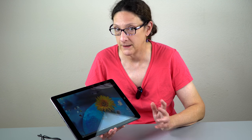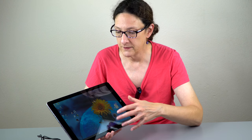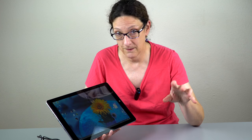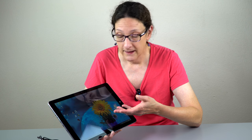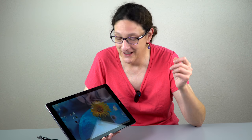The display is in theory the selling point of this tablet. Now, if you have epilepsy, be aware: this is the worst case of PWM refresh flicker I've ever seen — the camera picks up heavy rolling flicker. Though manufacturers often use more than one LCD supplier, and some users report a brighter, non-flickering display. We've tried drivers and disabled Intel display power management, and it's still doing this. In person, you can't see it with the naked eye, and I haven't felt any eye strain.